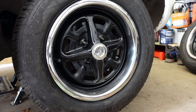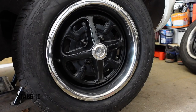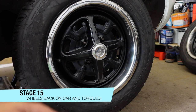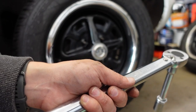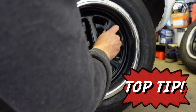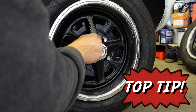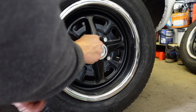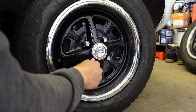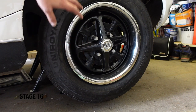Wheels just offered up to the hub. I've got some stainless nuts to go back on. I've checked the manual to confirm the correct torque setting on page 23, which says 44 to 46 foot-pounds of torque — cross-referenced, that works out as 60 newton metres. Obviously the paint on these is going to eventually wear, which means although they'll be tight now, there's a chance it will rub the paint off and the wheel might work loose, so I'll have to periodically check these. They're done up tightly but not fully tightly — I just wanted to make sure the rims were flush against the hub before the weight of the car was on it.